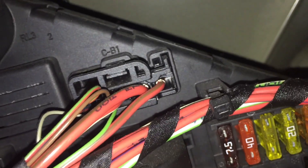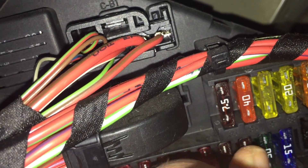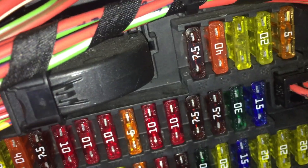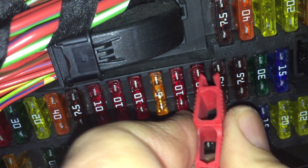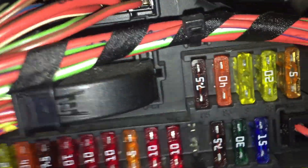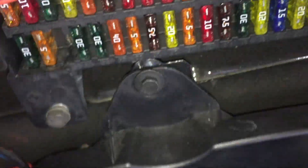Click it on — no, that just broke. So much for my BMW fuse puller. I will try the other side. There we go, number 81 is now pulled. Put them sort of in line where you pulled them out, so that you end up putting the right fuses back into the right holes, because those fuses are very different sizes.